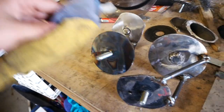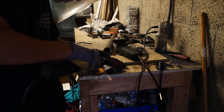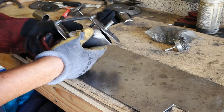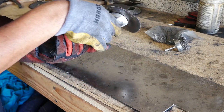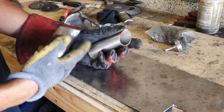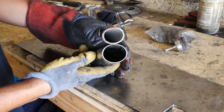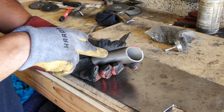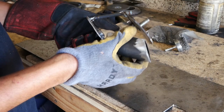We should be back to where we were last time. Mounts are out of the car — there's the left side mount, right side mount, and right side tube. Previously I was using inch-and-a-half DOM and now I've moved up to one-and-three-quarter inch, just a little bit bigger. The only reason I did that is I was running low on inch-and-a-half scrap but have a good amount of inch-and-three-quarter scrap, so I'm trying to use that.